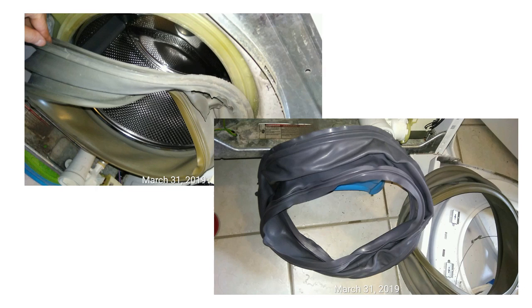The seal came off and that is the tank — it is plastic. At the end I will tell you that you need to cover this plastic with the rubber seal, otherwise it will destroy your laundry. The plastic can have sharp edges so we have to cover it, and the seal provides a portion that will cover it. Now compare your old seal and new seal — they may not be exactly the same color since color changes over time. Make sure you compare carefully that they are in fact the same seal, otherwise you might have to take it apart later.